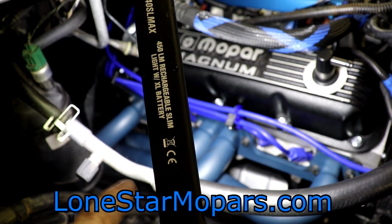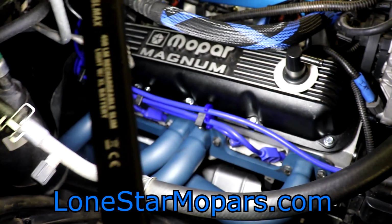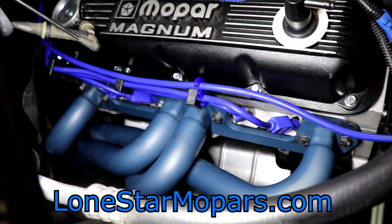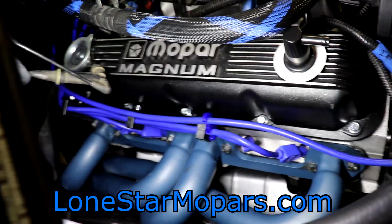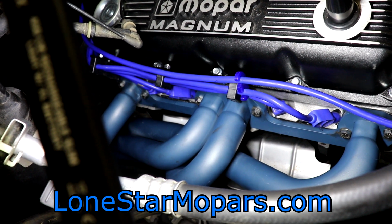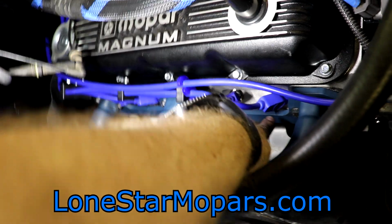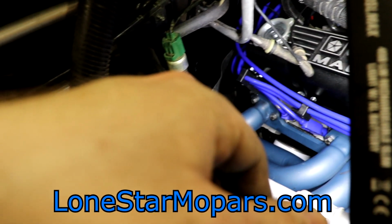And when I say tearing, I'm talking about sort of the filler piece that just keeps these all connected. It's not that big of a deal. I mean, that has zero sealing function on that flange. That's just kind of there to match what you would have on headers, or an exhaust manifold for that matter. But technically you could just have the ports, 1, 2, and 3 down there to cover your 4 ports basically. Obviously the middle one having 2 ports for your 4 cylinders total. But I kind of wonder if that's the deal, because like I said, it was kind of torn. Both tears are right about here, almost right below number 2 spark plug, and then that one's right below the number 8 spark plug. It's just starting to tear on the top side.